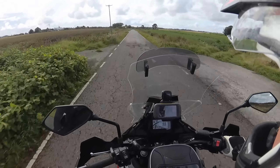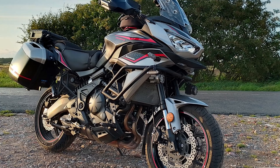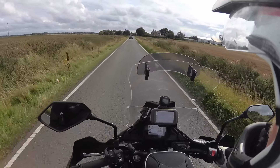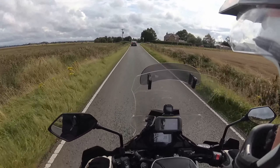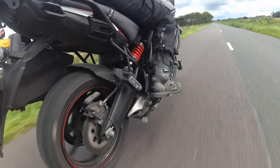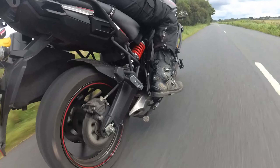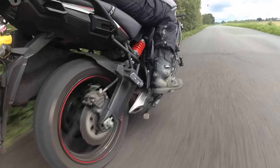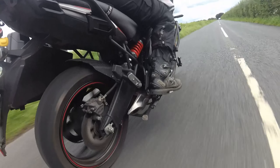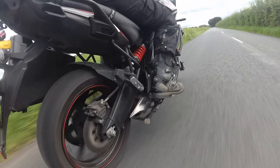To control all this luggage and weight — I'm carrying probably 12 to 15 kilograms permanently on the back, then there's me as a big unit, and the accessories weigh quite a bit, especially the centre stand. The rebound I ended up at seven from full hard, and it works really, really well. It really does keep the back end in check. And it also stops the patter when you're going over choppy stuff — it just stops the patter. It's a much, much more compliant shock absorber.